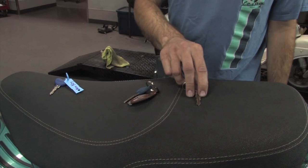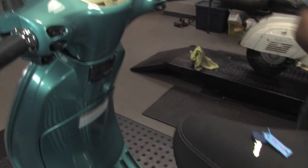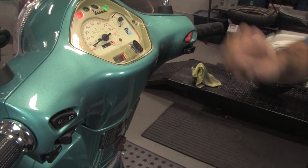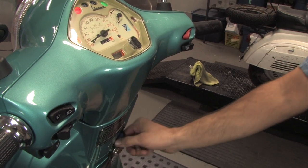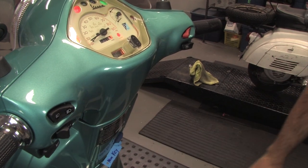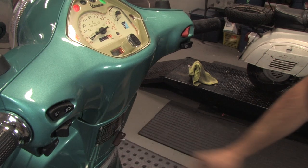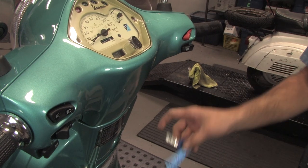Start with the red key — you need to do this pretty quickly and you need to be watching this immobilizer light. Start with your red key, insert it, turn it on, wait until that light goes off. Go with your next blue key, turn on, wait till it goes off. Then your brand new key that's just been cut — turn on, wait till it goes off. You can do any additional blue keys, up to seven keys depending on the system. End the process with the red key and turn off.